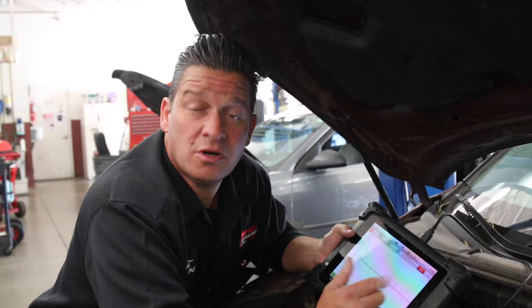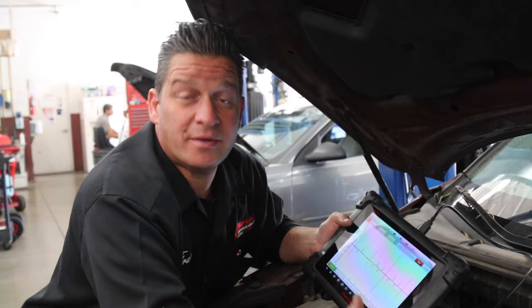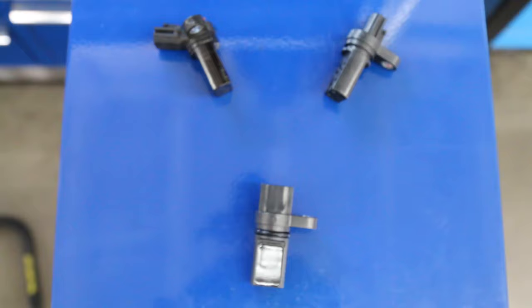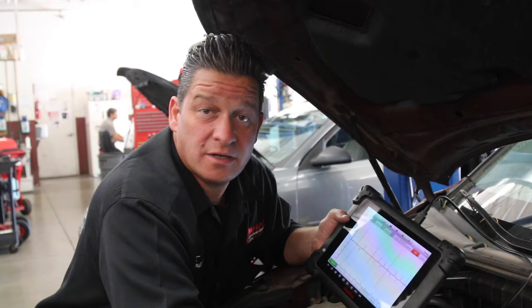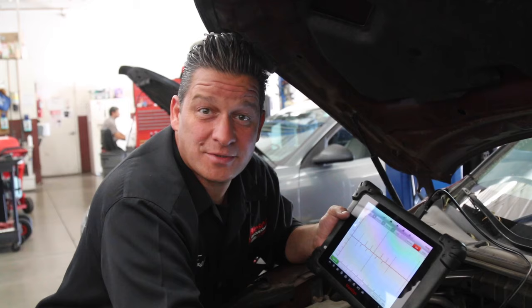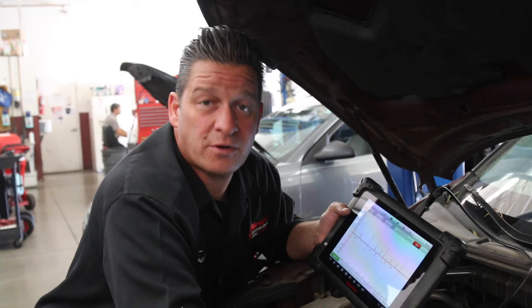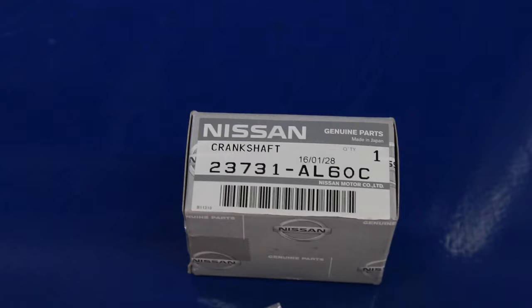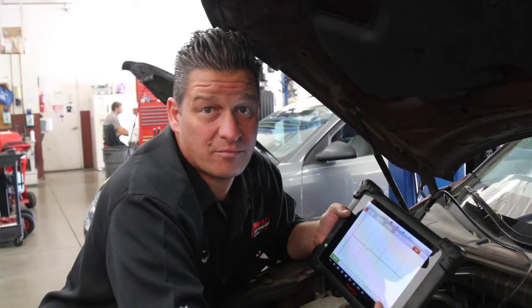For good measure we went ahead and tested the front bank sensor, which technically is supposed to be good — it's not triggering a fault code — and that is within specification. However, because of the mileage on these Nissan Muranos, you really want to replace those in pairs as well as the crankshaft sensor. The crankshaft sensor and camshaft sensors all work together — the eyes and ears for fuel injection pulse and ignition. We don't want the client to come back with the same symptoms and now have to replace that additional sensor. So we're going to replace all three. From our experience, if someone is selling their vehicle go ahead with an inexpensive aftermarket cam sensor, but if someone is keeping their vehicle you really want to stick to Nissan original equipment cam and crank sensors — there's a higher failure rate with aftermarket sensors.